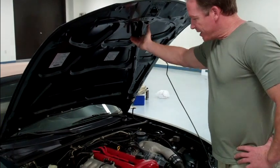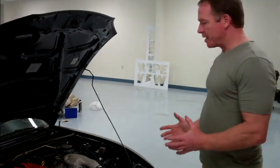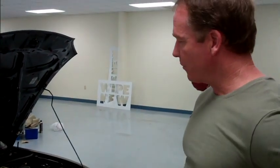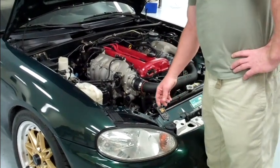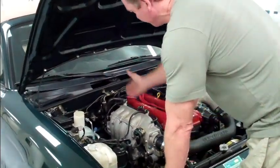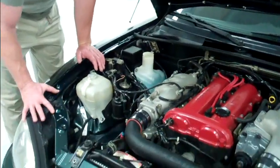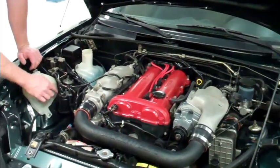You want to make sure this is very, very clean. We recommend a pressure washer if you have one; you can also use a garden hose. Typically we get a nylon brush — usually bigger diameter nylon brushes with a handle about four inches long — and a couple of two-inch paint chip brushes for dislodging dirt in all the little nooks and crannies. Spray your degreaser of choice — it can be Simple Green or 409 diluted at about a four-to-one ratio. Get the engine damp and work in sections. Use your big brushes for light housings, surrounding sheet metal, the firewall and the cowl, and your small brushes for all the busy spots.